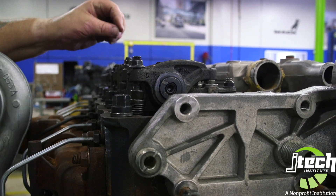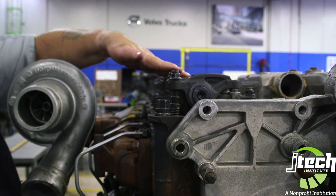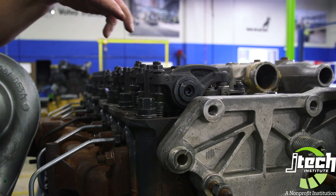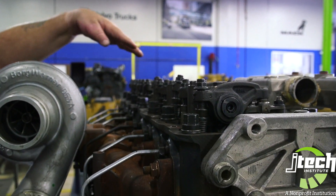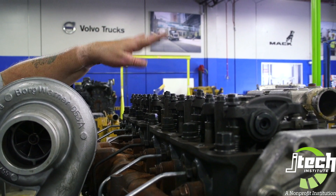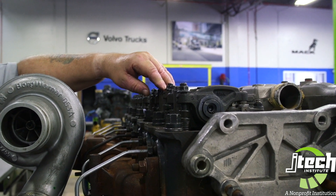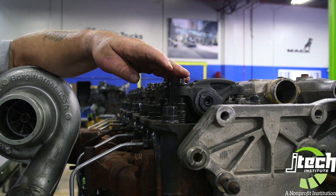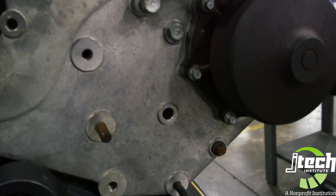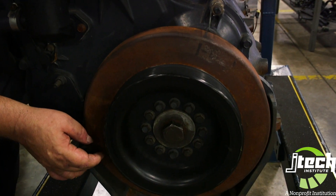There's a little rhyme that goes along with this because we know in our firing order that we have cylinders one, two, three, four, five, six. The firing order is 1, 5, 3, 6, 2, 4. If you're doing a valve adjustment by yourself, every time that you set a set of valves, you can set it by the firing order, but you have to rotate the engine 120 degrees when you change each cylinder. They're marked in increments: one and six, two and five, three and four.